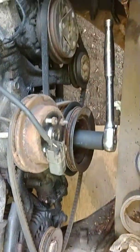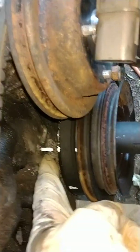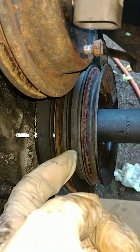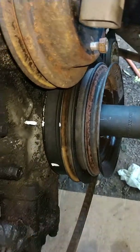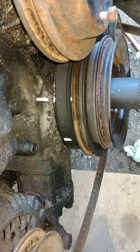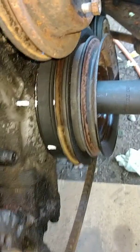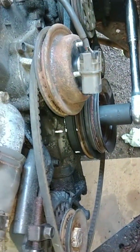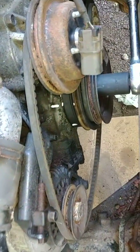I hope that helped you out about getting this thing to top dead center. Also, these pins — this is a trademark of a six cylinder. I don't know how come this is here, but there are marks on the pulley, and most six cylinders have a pin and there's supposed to be a gauge there, but there's not on this one. So this is kind of unique.